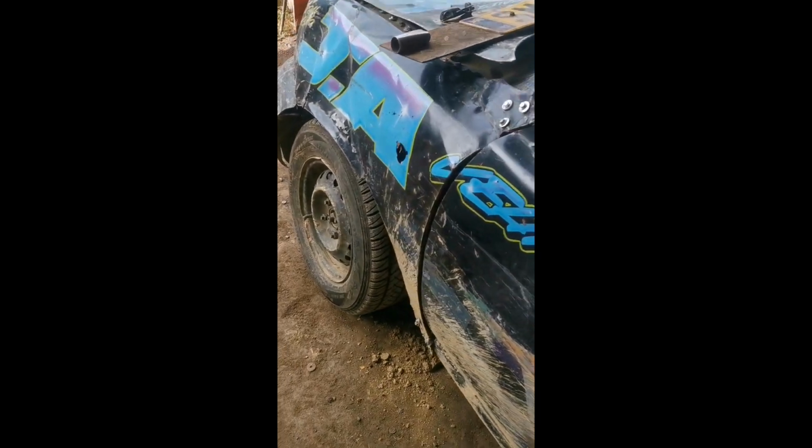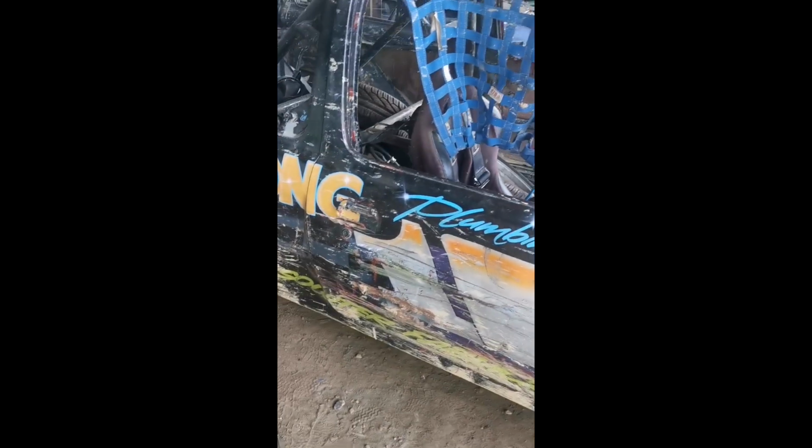Rear axle welded up. The rear panhard bar broke on this, which is this bar here. You can just see the welding that broke. That keeps the torsion in the axle, which, if you watch the last Smallfield video, was why the Smallfield car wanted to spin out so much in the final. Had damage on this suspension, done that. Just making up some new tyres now because we've ruined the tyre. Need to tie the bumper together because that's sort of failed a bit. A couple more checks to do and then that one will be ready.